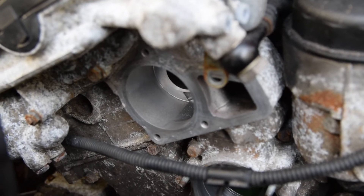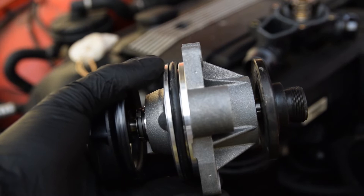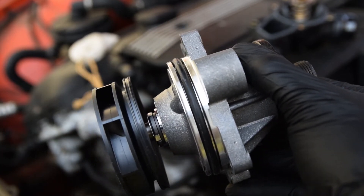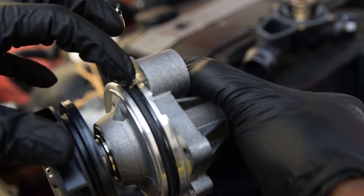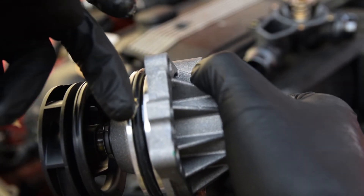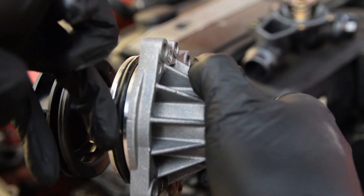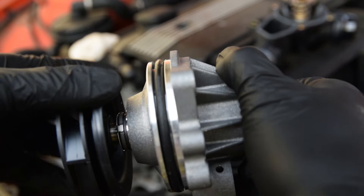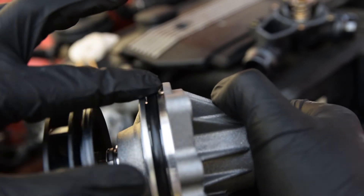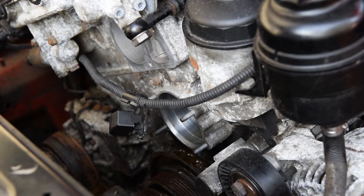I got this water pump from Country BMW in Hartford, Connecticut — shout out to them, they don't sponsor me. You want to lube the seal itself — not too much, just a nice lubrication right around the seal so that when you put it in there's no friction. Everything has some friction, so you just want a nice lubricant right around that ring so it seats properly.